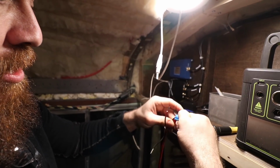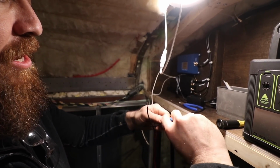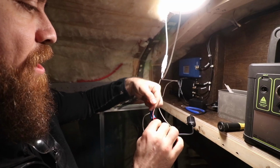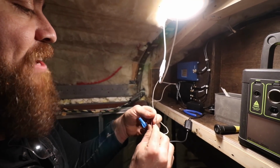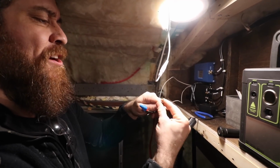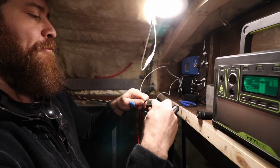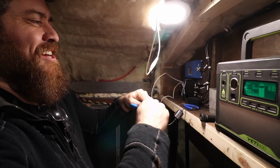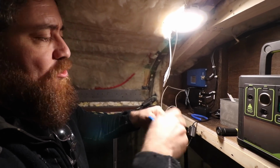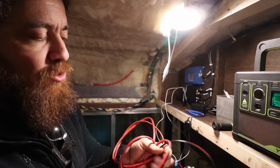All right, so the WeBoost has a 2 amp inline fuse. And I spoke with the tech support there at the 5G store, and they said that when running these to a fuse block, like we have down in the basement, to put them on a 5 amp fuse. So just so that they don't get over amped, like if a jolt happened or whatnot. So we're gonna have a 5 amp fuse for it down there once we run the wires. This is just to test it, to get it set up, and we'll probably leave it like this for a little while until we get the 12 volt wiring, because we got several things that we need to wire on 12 volt. But this will be a good temporary, the bus has internet sort of thing, hopefully.